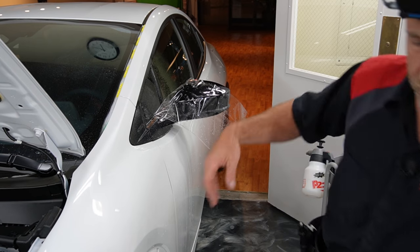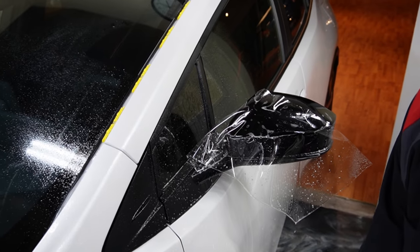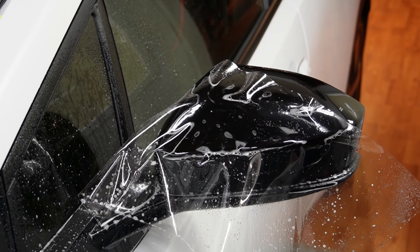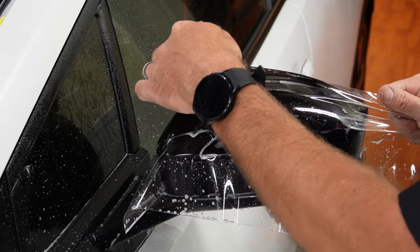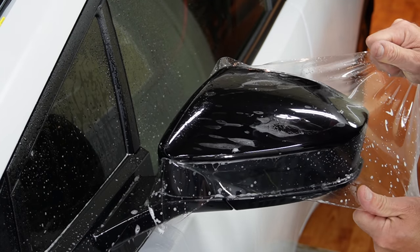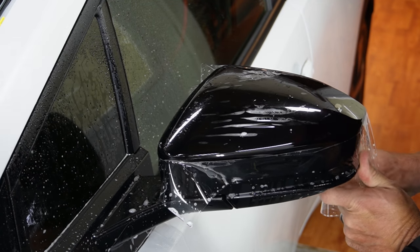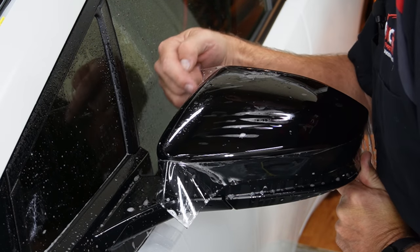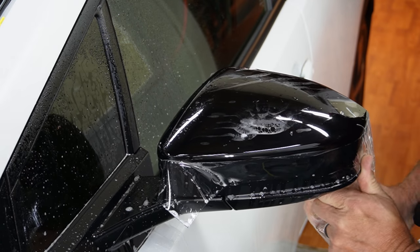Let's bring in a little bit closer here. Okay. So now we're going to go ahead and do our stretch. So as you can see, this finger is real easy to get rid of. It's this front edge that curls down that's going to be difficult. So we're going to continue to kind of turn the material back like this until we have that right at the edge. And then if we need a little bit more stretch, which we do, we can go ahead and put a little bit more into that. Perfect.